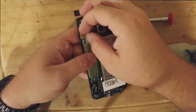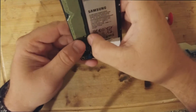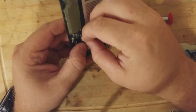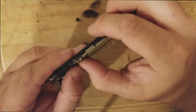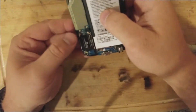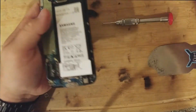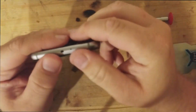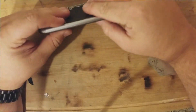My stuff is all OEM original — it looks really good. There's a lot of fake ones out there that don't have the original glass on there, and it makes it easier to break. So make sure you get original. If you have trouble getting original screens, you can maybe possibly find original on eBay; if not, I can get you some original displays. So I'm just plugging these little antenna cables in — you kind of have to finesse them to plug them in, and then just make sure that's lined up on each one. This charge port goes into there and we're going to slide that in first, push in, and clip and press down and in at the same time. So now we're sitting flush — everything should be starting to want to clip in, and we are going to screw in all the screws.